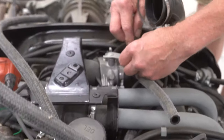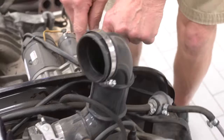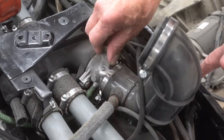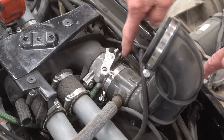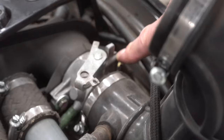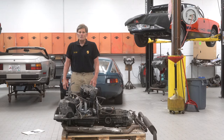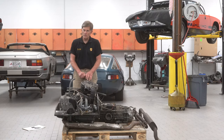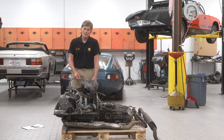Finally, the throttle body: there is a spring — people have asked me where it connects — and you can see the little hole right here. This is the throttle return spring; it goes right back here so that if the spring is not on there and you let go of the throttle it could just flop and you could have the engine revving out of control. On the throttle body we talked about the vacuum advance and vacuum retard, and this is the idle screw to set the idle correctly after you set the dwell and after you set the timing — then you can set the idle at 950 RPM. Thank you very much for listening. Here at Automobile Atlanta we're always open for advice, so don't hesitate to call us — we've been in the business for 43 years and I always say that if we don't have the 914 answer, no one does.